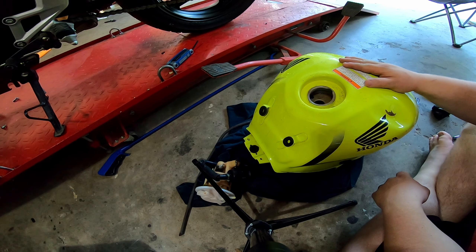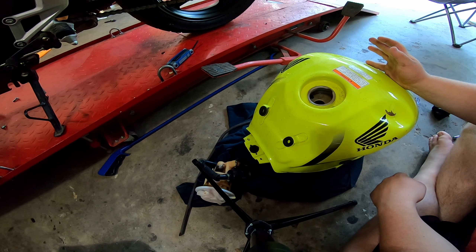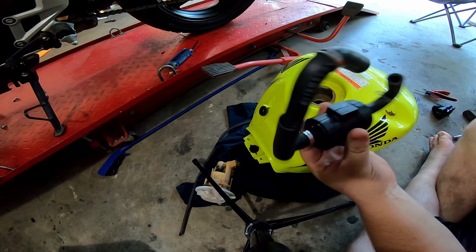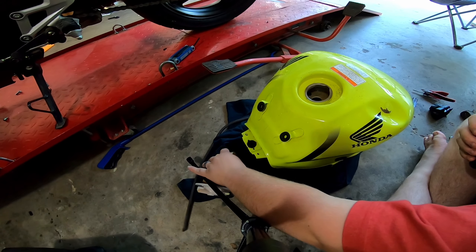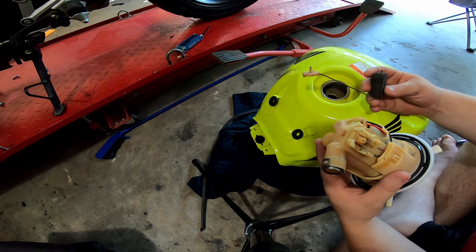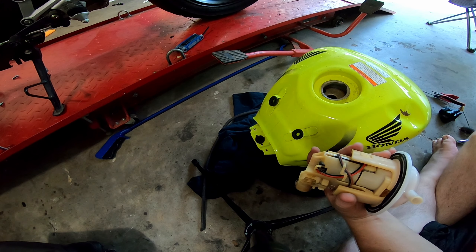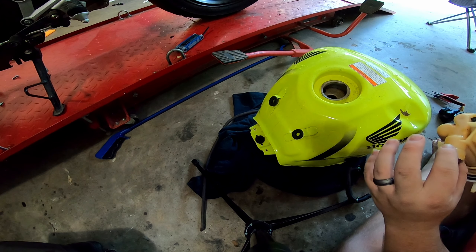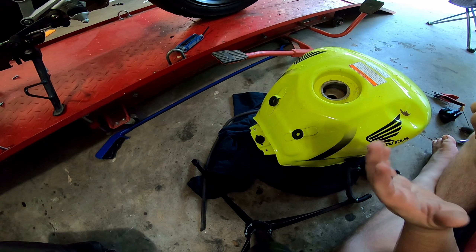The tank is a little more rusty than I thought, but I got all the big stuff off with a water hose — got all the water out as much as I could, wiped it down. I've also got an ultrasonic cleaner. The float did break off the fuel pump and I don't have the ability to solder, but we can still put this together and see if it'll run. If not, we may have to look into the injectors.